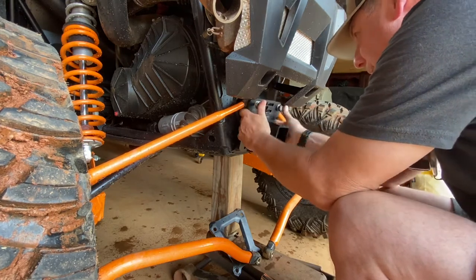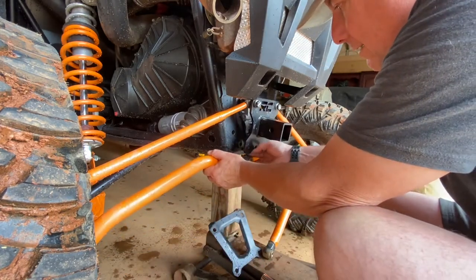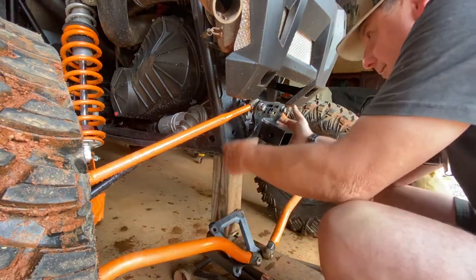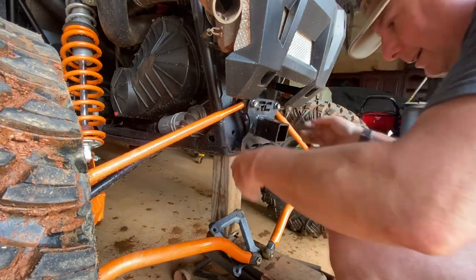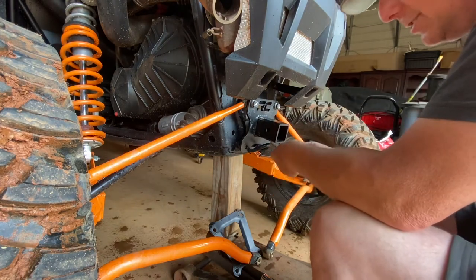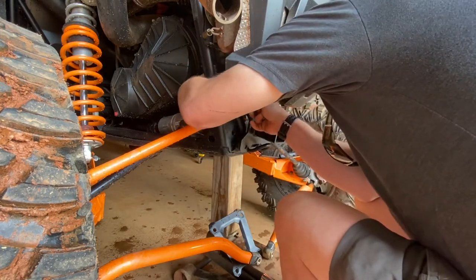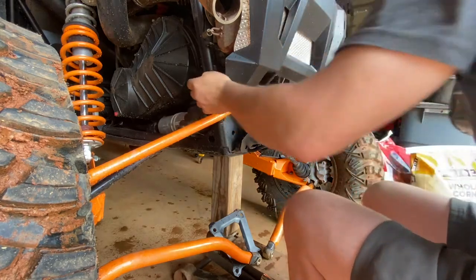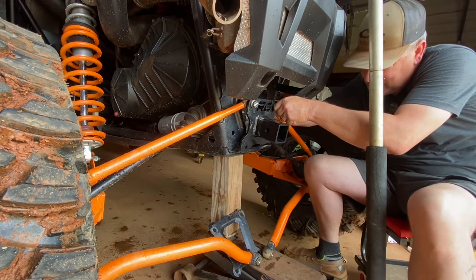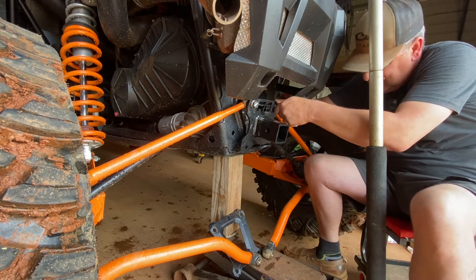What we're going to do is get these two upper bolts in and get the nuts started on them, then pull the tire out from the bottom a little bit to get the sway bars to go in. The nut on the top is pretty easy to get to — you can actually reach it by hand. The bottom one is a little tougher because the skid plates are in the way, though they're there to protect things, so it's good that they're there.